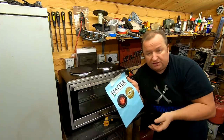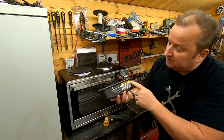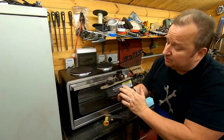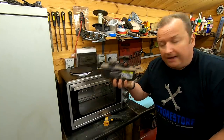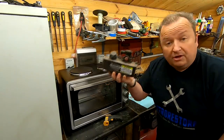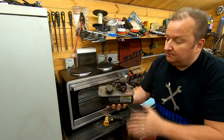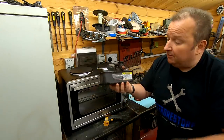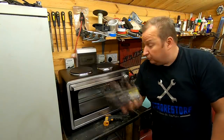When I'm able to powder coat these and get them totally glossy, I've now got the facility — I'll photograph or find decent decal originals, take them into Photoshop, size them up, and print out as many as I like to refurbish these. And if I wanted to, they sell for £25 to £30 on eBay as a complete set. All I've got to do is powder coat them, put new diaphragm and gaskets in, clean them up, clean the jets out, re-powder coat them, put the new graphics on, and hey presto — that'll be a saleable item, plus restore them whenever I do them myself.